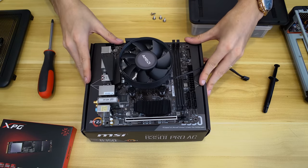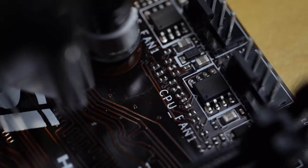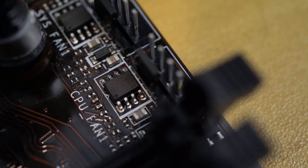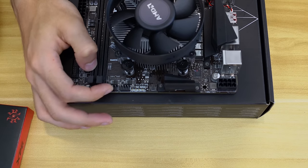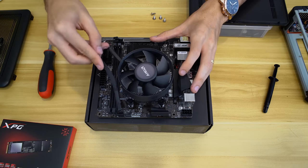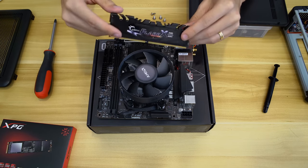At this point your board might flex slightly from the torque — that's okay, these boards are designed to be somewhat flexible, just don't torque it into a U-shape. We have a four-pin PWM fan cable to connect to one of the CPU fan headers — there are two up top. Some boards won't let you boot into the operating system unless a fan cable is connected to the primary CPU fan header. In MSI's case it probably doesn't matter, so we'll plug ours into CPU fan header one. The connector is keyed, so you can't install it backwards.